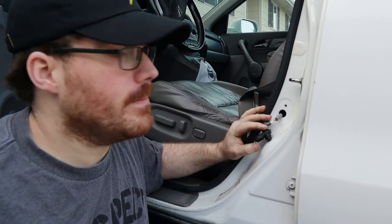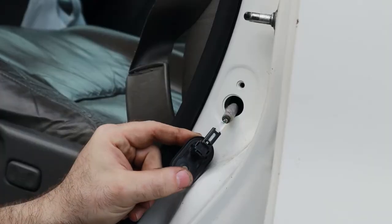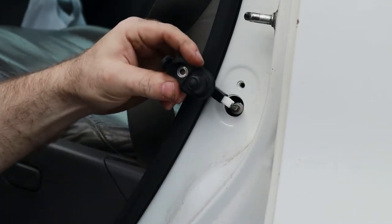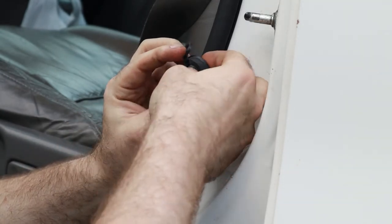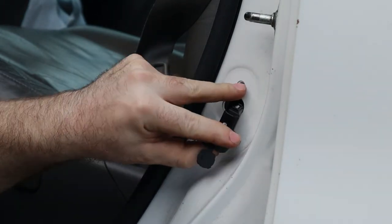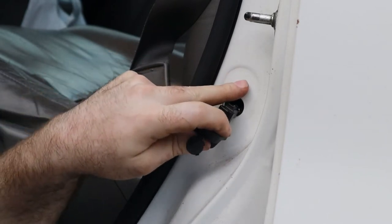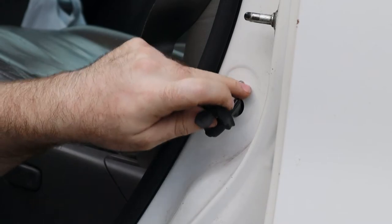Something I had in the back of my head when I was digging into this: typically with a switch you have a hot side and a neutral side. Your hot side would have positive 12 volts — it's a car, so 12 volts. I'm guessing that's what this wire is here. There's only the one wire, and that switch only has one wire on it. This switch has a flat metal washer piece, and this bolt screws through that into the frame of the car. So the other wire in my case is the frame of the car — the neutral or negative. The whole frame goes back to the negative on the battery. So when this switch clicks, it's connecting the 12 volts to the frame of the car and making that switch.